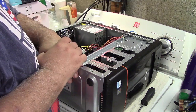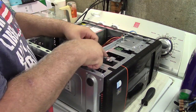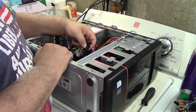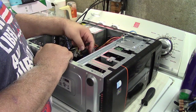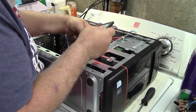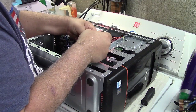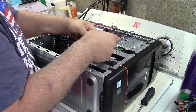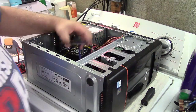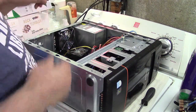The other thing that we need to do is install an SSD. So that's going to connect here, and the reason we're doing that, this drive has Windows 7 Home Premium 32-bit. I need 64, because I can't run a 32-bit OS anymore. So we're going to leave that well enough alone, and we're going to go ahead and install a new SSD drive, because it's a great test drive and it's quick and it might actually work for this, and it's now installed. That's going to be just fine. Okay, it's better. It's installed now. That's all you need, just for now.